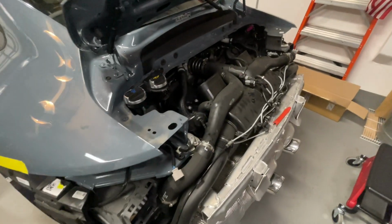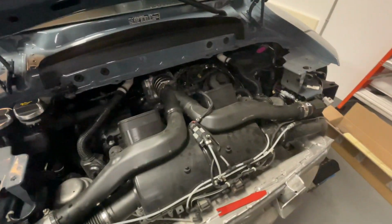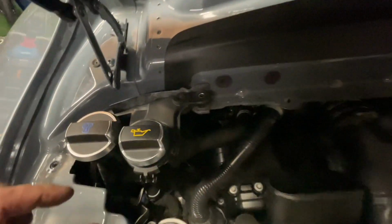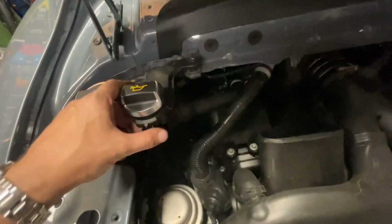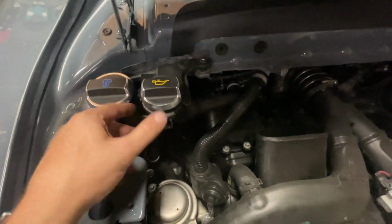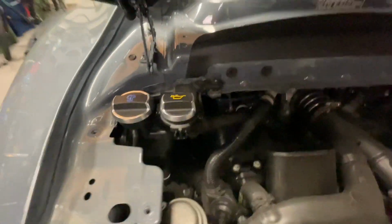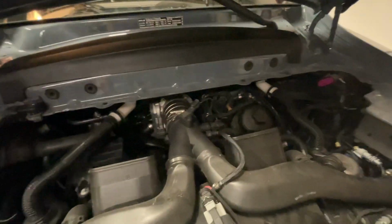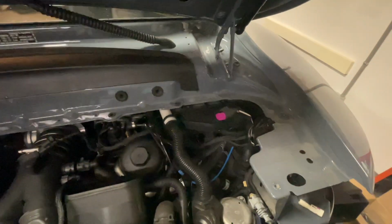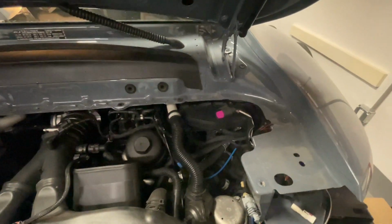All right, spoiler is removed. That was a little tricky, not too complicated. I had to remove this little 10 millimeter bolt there in order to separate this part here, which is where you fill the oil reservoir. You can see where the oil goes down into the engine. And I had to disconnect that plug, which I snapped a little plastic connector thing and broke it. And well, I don't expect that to get fixed because